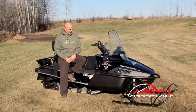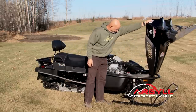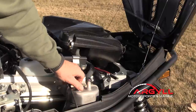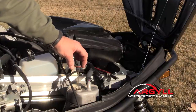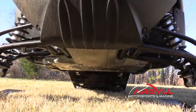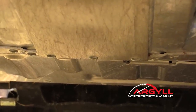I did an oil change on it — absolutely as easy as pie. Here is our oil reservoir — you just unpop that sensor there. Here is the dipstick — pull it up and you can check the level of your oil. You go in from the front where there's an access panel for getting at the drain plug on the motor and the oil filter.